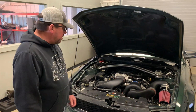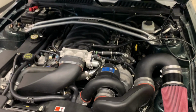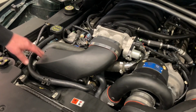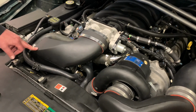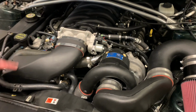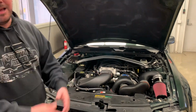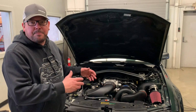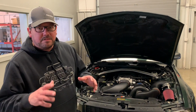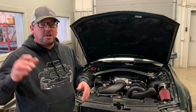Doug, check this out. I love this, the black. It's the blackout kit. It's the VORTECH, it's the V3, it's the HO kit. So we're talking intercooled, it's liquid cooled. So a lot of you watch our Paxton Novi 2200 videos, that's air to air. This one's liquid cooled. Stock manifold, stock throttle body, stock cams. It does have a set of pipes headers, all right? So we're talking basically a stock Bullitt Mustang with pipes headers and the V3 HO Brenspeed package.